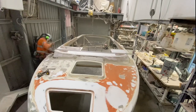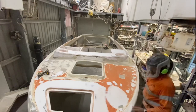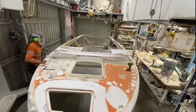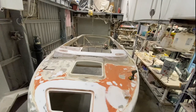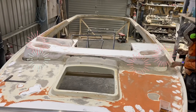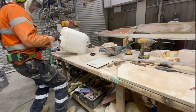I used my lasers last time because I've got the hull and the deck all level from the laser, so the deck should all be straight. Measuring from the top of the deck to the top of the dash is the most accurate way to make sure that I've got the dash symmetrical. This is where I've got the four screws that locate where the dash needs to be.